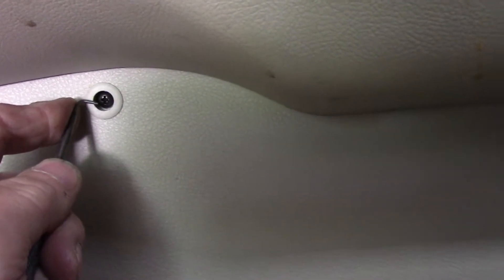Make sure we have no other screws — and sure enough, there's one more screw there, so let's take that out before we do anything to pry this off. The way you get it out is to come in here with a small pick or anything that fits into that hole, pull it, and it pops right out. That exposes a Phillips head screw underneath, so put that piece to the side, grab the screwdriver, and unscrew that Phillips head screw until it's totally out.